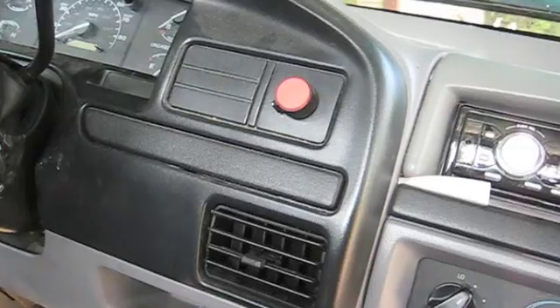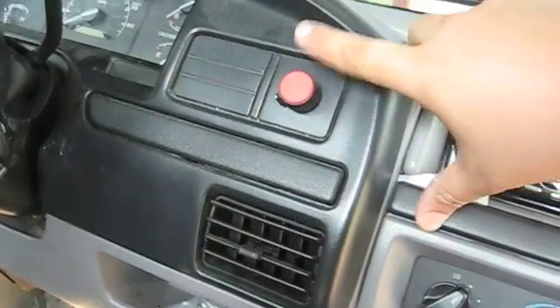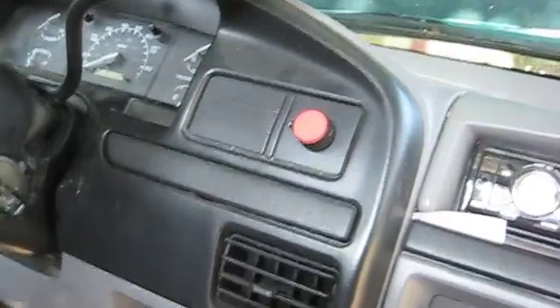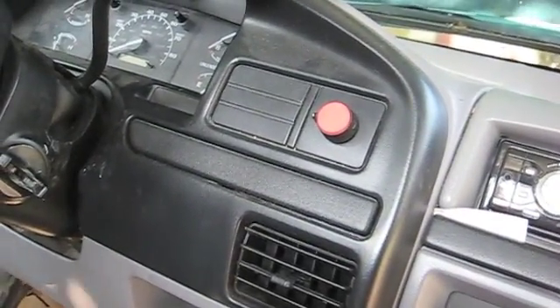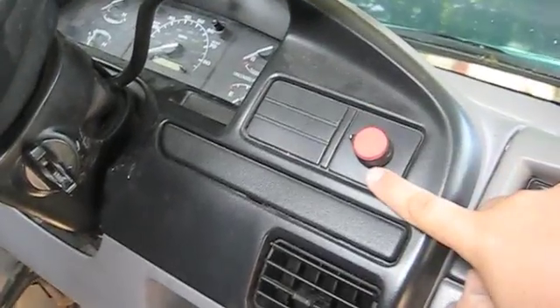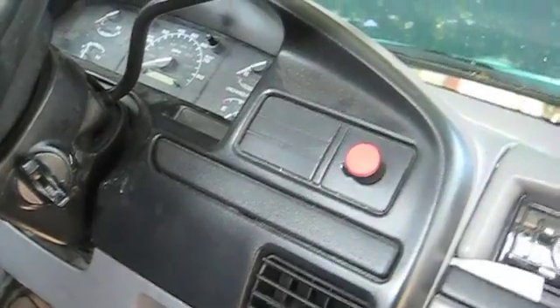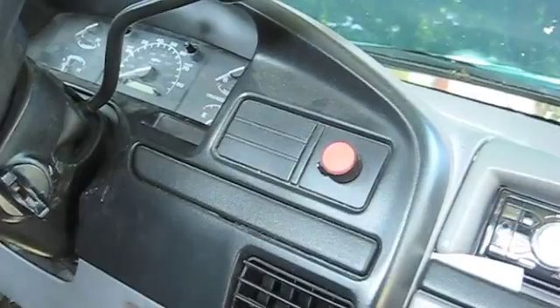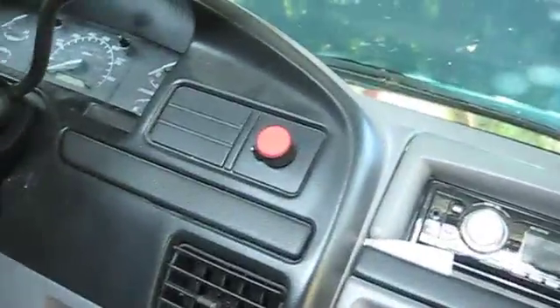That's the oxygen sensor and the little silver collar on it is the extender that brings it three-quarters of an inch out of the tailpipe. This knob is for my MAP adjuster, but I've actually disconnected it right now because with the O2 extender collar on the O2 sensor the mixture was running lean enough and my temperatures were getting pretty high. Some vehicles need the MAP adjuster, some don't — it just ran too lean in this one so I disconnected it.